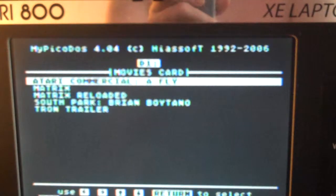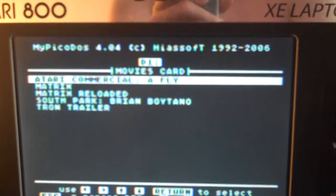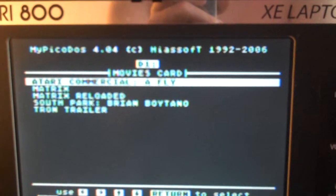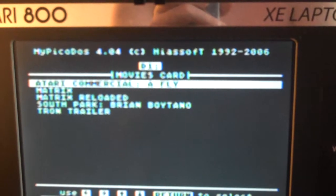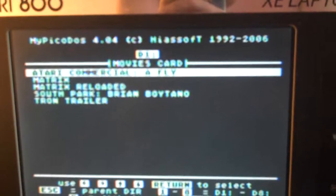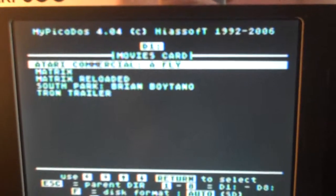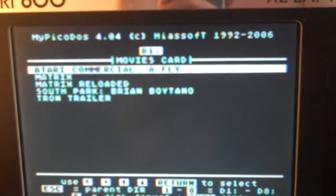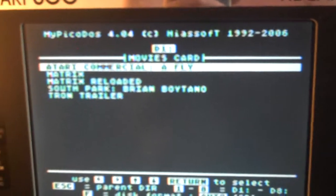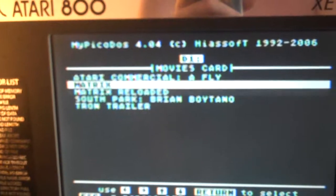It's pretty low resolution — 64 by 96, playing at roughly 7.5 frames per second. The audio is being streamed directly to the sound chip using an undocumented mode to send raw digital data to the chip. Four bit samples at 6144 hertz sample rate. So the sound quality is not the greatest, but the sheer fact that this can be done at all is nothing short of miraculous.